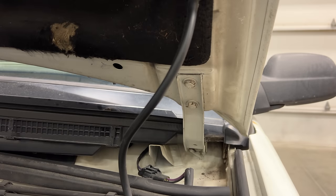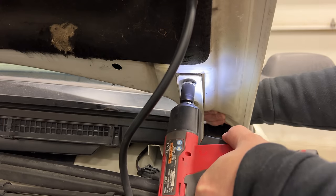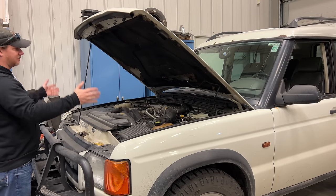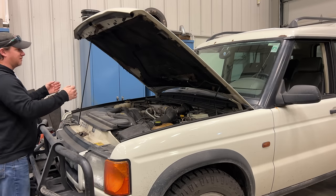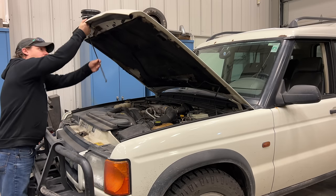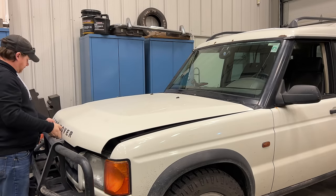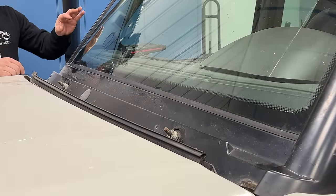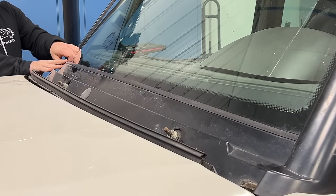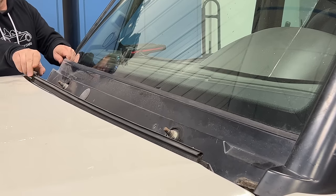I'm going to have to move the bonnet forward a little bit, so I'll undo the two bolts on this side and the two bolts on the other side to loosen the bonnet. I have the bolts out of the hinges on both sides. The only thing holding the bonnet up right now is the hood prop. So now I can put that down and slide the bonnet forward just slightly. This cowl piece gets tucked underneath the side, so if I slide the whole thing that direction, pop out this side, I should be able to pull it this way a bit and get the whole thing to pop out.